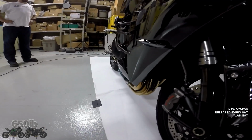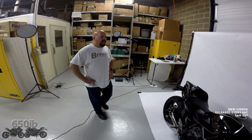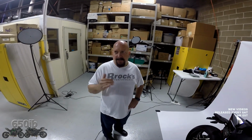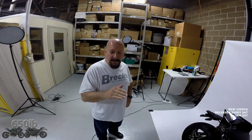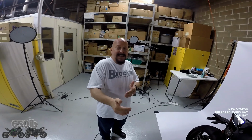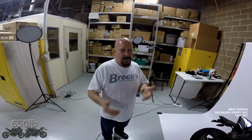No. Awesome. And in drag racing, there's a rule of thumb that we'll pick up about 1/10 of a second in the quarter mile for every inch that we lower the center of gravity for the bike. Okay. On a bike like this that's so short and so wheelie prone, you'll pick up more than 1/10 of a second. And in the quarter mile, 1/10 of a second or 2/10 of a second, you're getting killed. Right. There's nothing you can do about that. Yeah. And that's what matters.